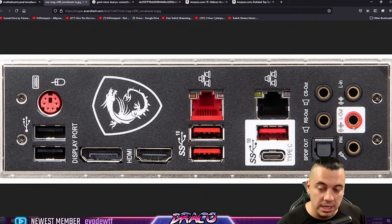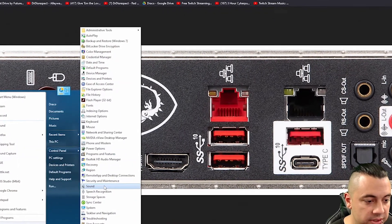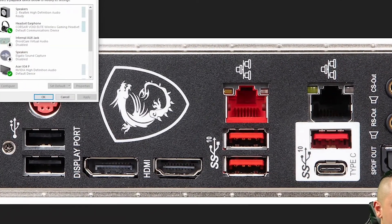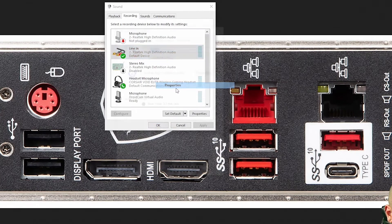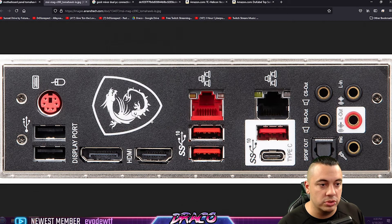You can do all this routing between the two PCs with just one cable from your line out to your line in. Go into Windows sound options, go to Recording, go to your line in Properties, click the Listen feature using your default playback device — which is your headphones. Now everything coming from your streaming PC is going into your headphones and you're able to hear it as well as control the volumes in Streamlabs or your digital mixer.